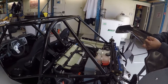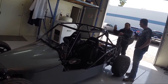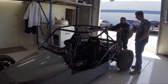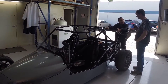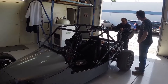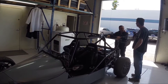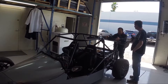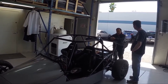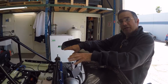When evaluating the battery we looked at three things: voltage, capacity, and volumetric efficiency — how does it package? It's not the smallest battery but not terrible. The other benefit is Chevy really engineered this to be a very long-life battery. They didn't want failures that would be a black eye for them, so the pack is overbuilt. EPA did a study, and people on YouTube talked about it — you can pull a lot of current from this pack, even though the Volt itself never did. They really underutilized this battery in the Volt.